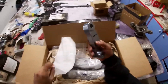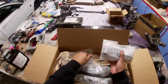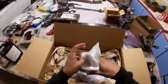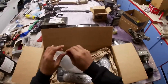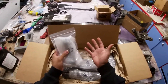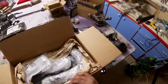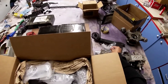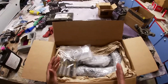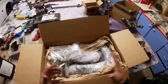That's about it for the angle kit. This kit was $850. I think it's a very nice price for what you get — all the other Mustang angle kits were over a thousand dollars, so this was the cheapest one. One big thing I like about this angle kit is it looks very streetable — if I want to drive it on the street it won't mess up my street driving going from point A to point B. It's also a very good drifting kit. Another thing I really like is that it's adjustable, meaning you can easily go from your factory angle to the max drift angle, and easily go back to stock Ackerman.